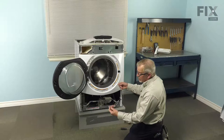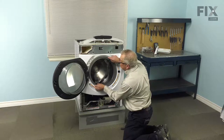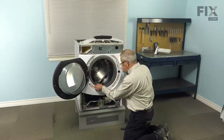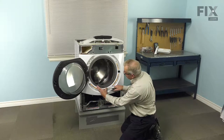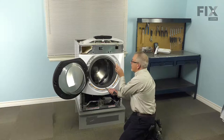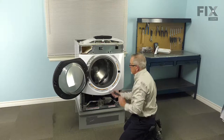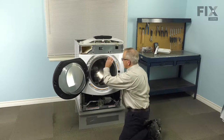Now we're ready to reinstall the wire clamp. Position it so that the spring will be in the six o'clock position and make sure the wire fits down into that groove. The safest method is to take a pair of needle nose pliers and grasp that hook on the wire portion so that you're actually pulling the spring. Get the wire around as far as it will go, stretch that spring, tuck the wire in the rest of the way, and it's secure.